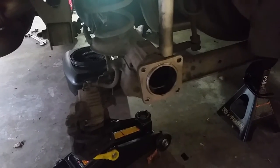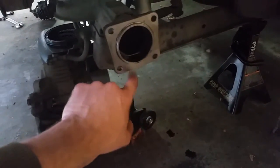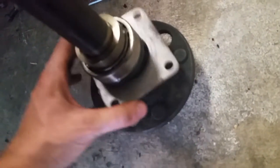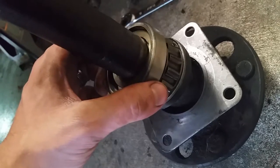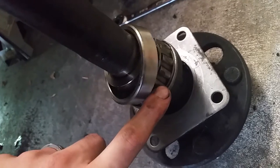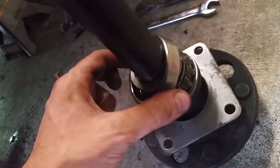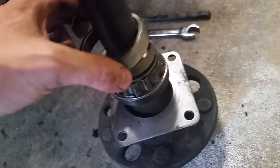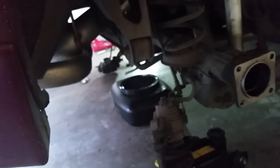If you have this rear end, this is my other cleaned-up side. This piece is part of the rear end — I cleaned the outside to get a good seal when putting it back on since I don't use C-clips. Where the bearings are, I cleaned off the bottom. The bearings in here were unexpected; I don't know how to pull them off, but they're good so I'm not going to replace them — just re-grease a little. I read online that rear bearings shouldn't be packed completely full of grease like front ones because of heat. So re-grease it, not a hundred percent full. Everything looks good, so I can put that back in. I do need to replace my diff fluid anyway, so it's a win-win.